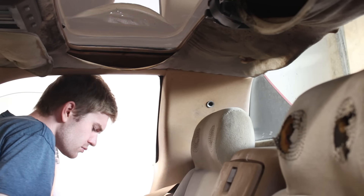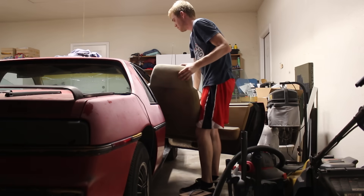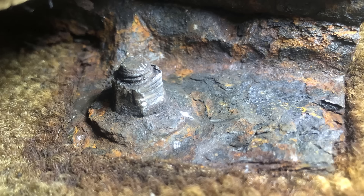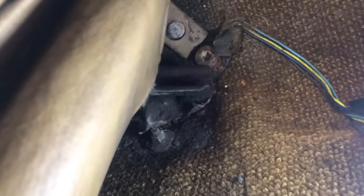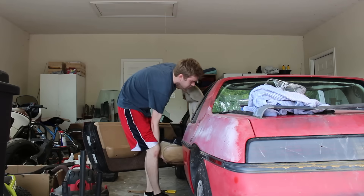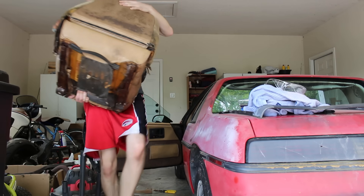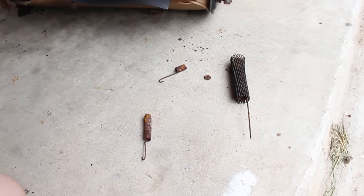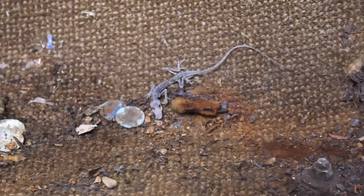Starting from the top and working my way down, I had to take out the top seatbelt anchors to remove the trim that held up the headliner. With that done, I realized it would be easier to work with the seats out. The passenger side came out just fine, but the driver side gave me trouble — the slide rails were stiff and the back two nuts were incredibly rusted. I ended up cutting the middle seat rail completely off and wiggling the seat until the outer side broke free. With the seats out, I managed to hammer a socket onto both nuts and got them out. The springs had completely rusted apart and the sliding mechanism wasn't working at all.